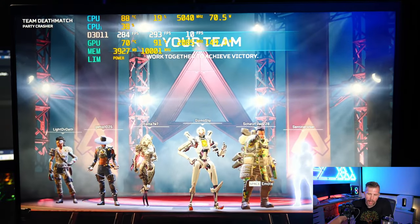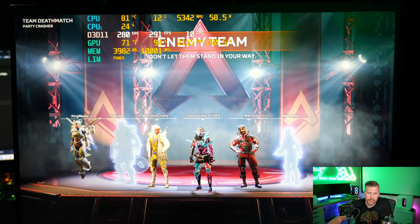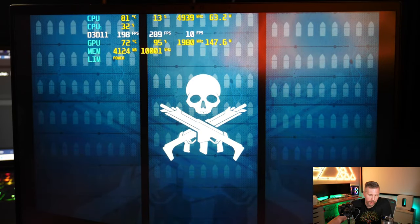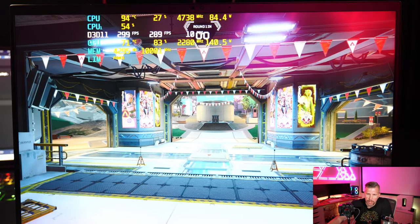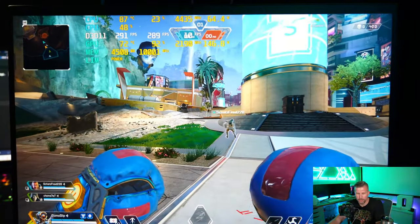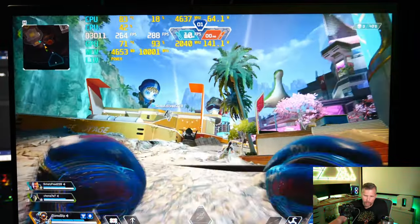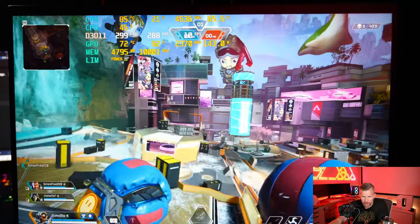Is the screen flickering issue still there? Yes, it is. It is an issue if you are in advanced Optimus mode right now. The Intel integrated GPU driver is messing up, causing the screen to flicker. So I'm in dedicated GPU mode. The flicker is not bad at all for me right now. The flicker does not exist, as far as I can tell, in discrete mode.